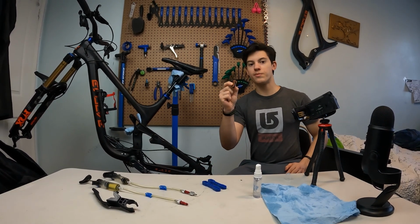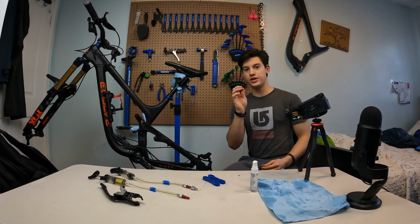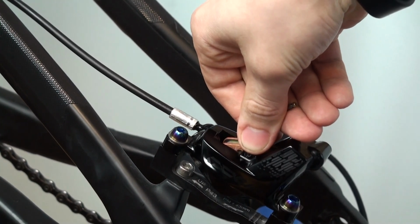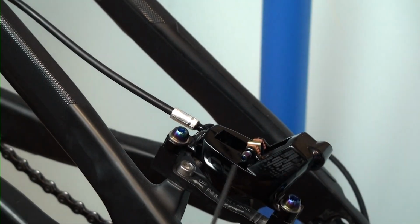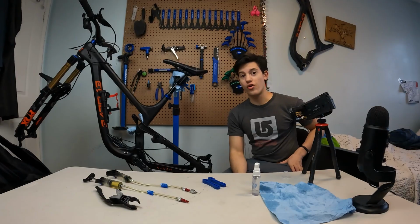Alright, now take your brake pads, and now you can insert that in there and screw with the actually given screw and secure it with that protective pin. So put your brake pads in there. With a 2.5mm Allen key, screw that in and secure that with the little pin. Alright, so here we go.